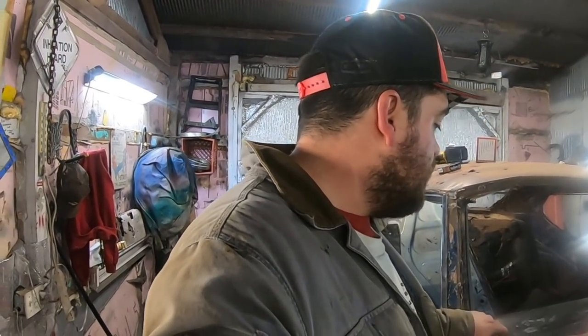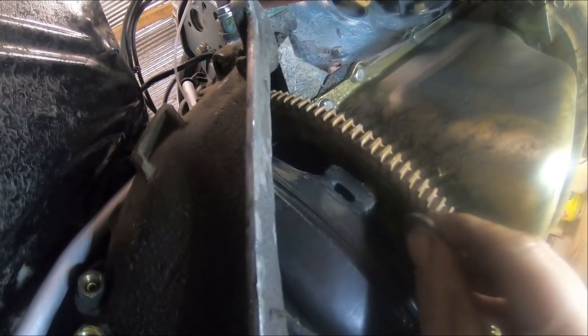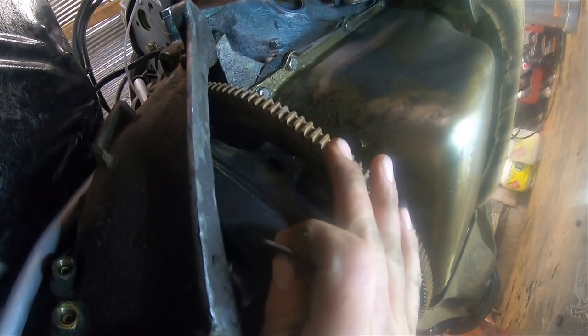We're going to go ahead and put our torque converter bolts in. Get yourself a flywheel turner — super handy, man. You don't have to be bouncing back and forth or using a screwdriver against it. They're like 20 bucks. When you pull the torque converter out of the transmission, there's going to be a gap between the converter pads and your flex plate — usually you don't want more than a 16th of an inch max. Ours is pretty tight. I'm just going to use some washers to shim the bolts. I wouldn't suggest pulling it out a quarter of an inch — just this little washer to shim it will make that about a sixteenth of an inch, which will be just about perfect.